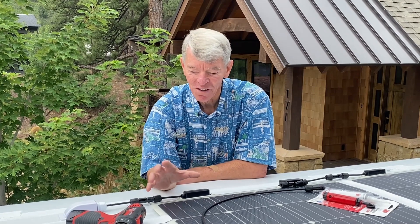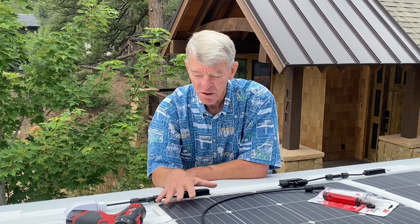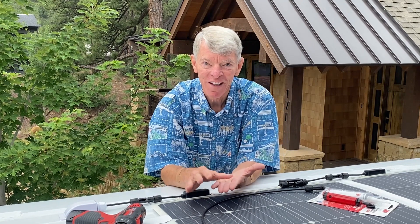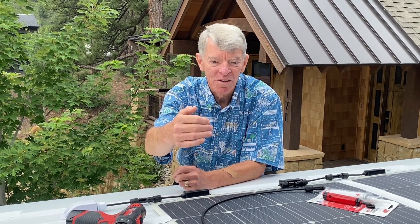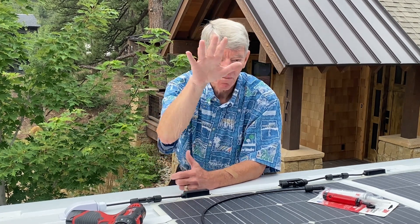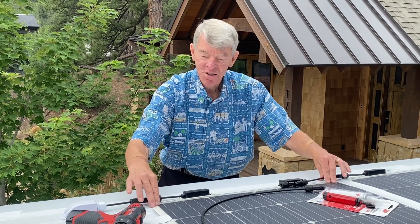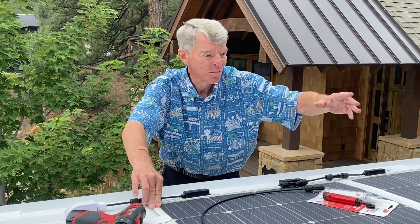I got it all right — all three panels are interchangeable because I got all the lengths to match. Now I brought them back out, ready to put them up on top of the van. I have all these velcro strips across the van roof, and I didn't want to put the panels down misaligned because once it touches the adhesive on the back of that velcro you're not moving it without pulling the velcro off. So what I ended up doing was laying down multiple PVC pipes on the roof — left over from a previous project — so that when I put the panel down it wasn't touching the velcro. I could peel off all the backing, put the panels down on top of the PVC, then work on getting the alignment just right. I set all three panels down, made sure they all lined up and were nice and parallel, and everything looked great.